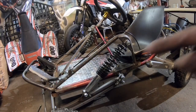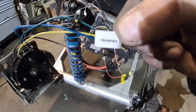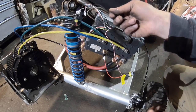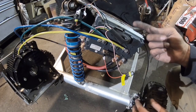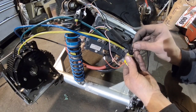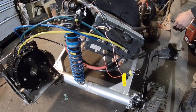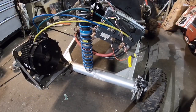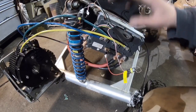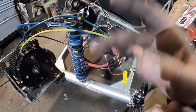Now we need to figure out that reverse situation. Actually found the problem — there's a little tag on the wire that says 'reverse,' which is these two wires. I think if I connect them it will put the go-kart in the other direction so it drives forward. Let's use our temporary jumper key, power up the go-kart, tap on the gas and see what happens. That definitely fixed it — that's what you have to do. Eventually I'm going to put that on a little switch on a dashboard so we can go forwards or reverse. But for now, I really want to go test this thing.